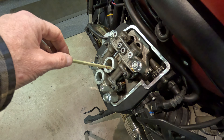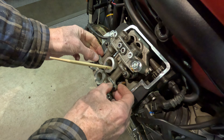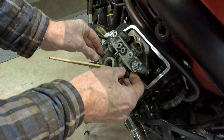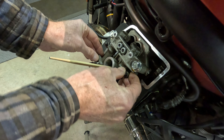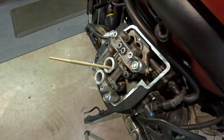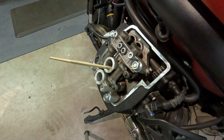The left hand rocker cover is off. You'll see a chopstick in here — I've marked it where top dead center is roughly. I've gone around a couple of cycles, through the suck, squeeze, bang, blow cycle. You can tell you're in the right cycle for adjusting because when you move the rocker heads they actually move very very slightly.